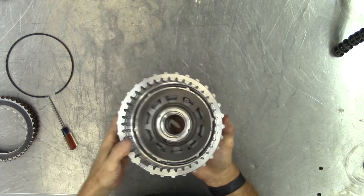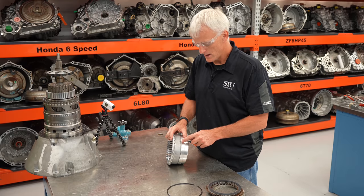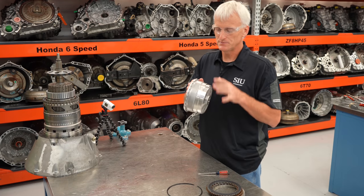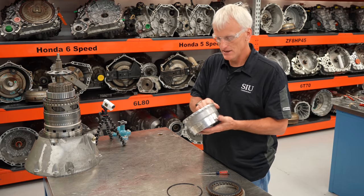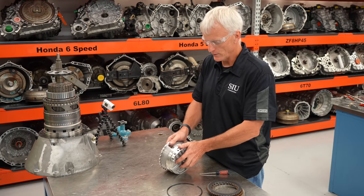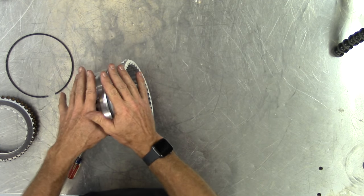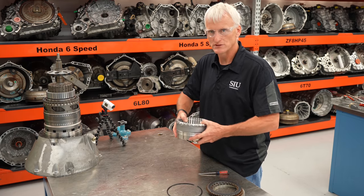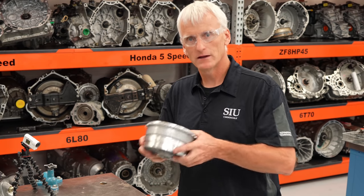We also have a dish plate here — dish facing up, toward the snap ring when taking it apart. To remove the diaphragm spring's snap ring, I need to compress the spring. Before taking this apart, I'm going to put a scribe mark all the way down in a non-critical area. The piston assembly and housing can only fit into the case in one way — the bolt holes and splines must line up. Since these two parts aren't connected, if they're clocked differently when going back together it's a pain because the diaphragm spring puts so much tension on them. Lining up scribe marks makes reassembly much easier.